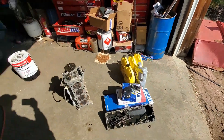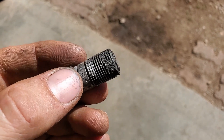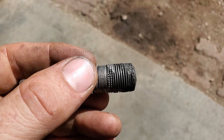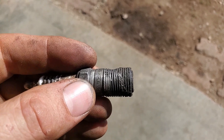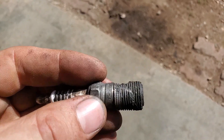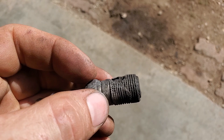So we're putting another cylinder head on it. Here's my theory as to why this failed. I think this helicoil failed because the spark plug now seats on the helicoil insert rather than seating on the cylinder head, so it's pulling on the thread. As vibration happens, the threads of the helicoil can vibrate up and down, damaging the helicoiled threads in the cylinder head, and the spark plug is not actually pulling tight against the cylinder head anymore.